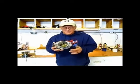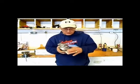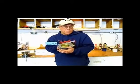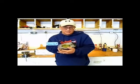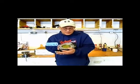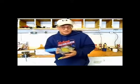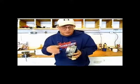In some GMs, this will cause what's called the Gadgetman plop, which is caused because of the groove that's machined in this plate here. You may be able to see it from that angle. Since the groove is always charged with air, when the key is turned off, it cuts off all power simultaneously to the system. So the groove is charged with air, the engine's running, then the computer turns it off and it tries to relax it. What happens is the pressure inside the groove will snap that throttle plate shut, and it makes it sound as though you're slapping your hand on the end of a hose. Let's see if I can make it happen here. Something like that, only a lot louder.